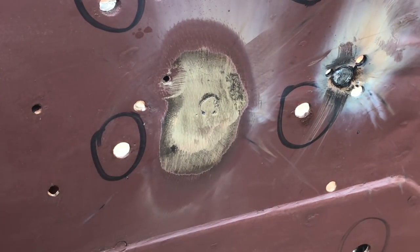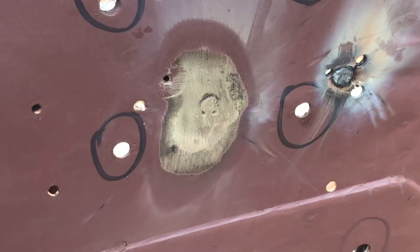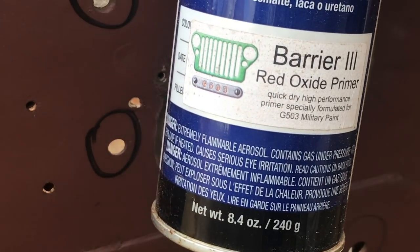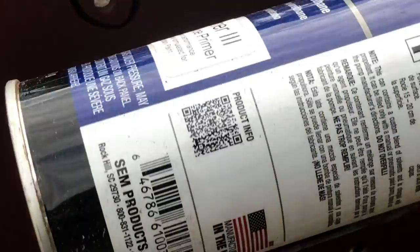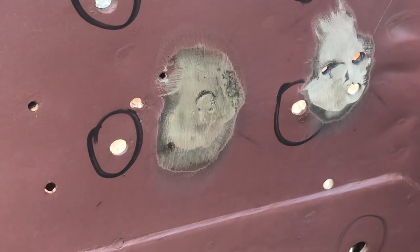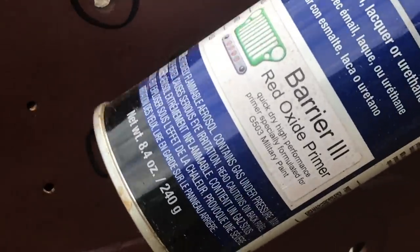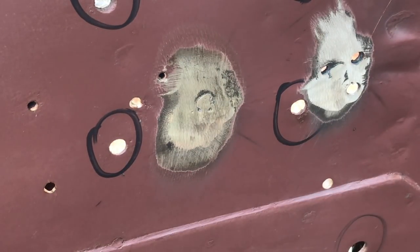Let's say you're working out here and it gets late, or you've got to go for dinner and you really don't want to stop — but you've still got these holes left. Let me show you what to do. Wipe it up a little bit, clean it up so there's no residue. Then take the Barrier 3 red oxide primer from Ron Fitzpatrick Jeep Parts — the rattle can makes it really handy — and just give it a little coat of primer. It won't flash rust on you until you come back to the project, and again this is weldable up to 2 mils, which is a fantastic thing.